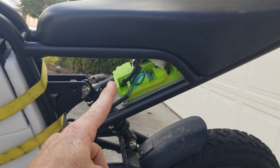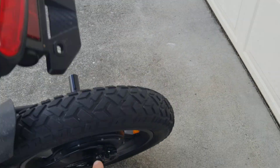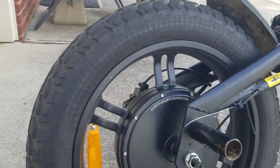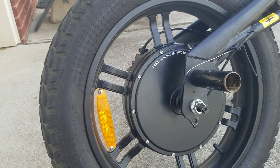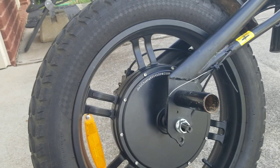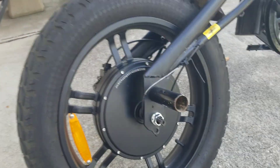It's over-specced — that controller is 300 amps and we were told by the Loon Yee people to keep the hub at 80 amps, even though it's 4,500 watts. Just trying to play it safe right now. The bike as it is gets up to about 50 miles per hour, topped out, and that's a conservative tune on the Fardriver.